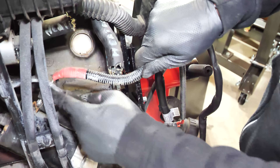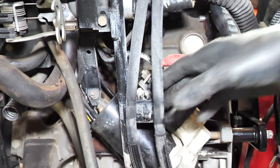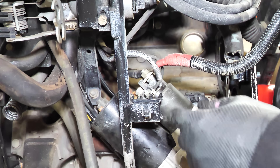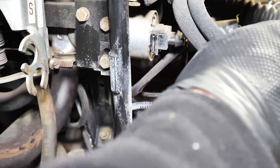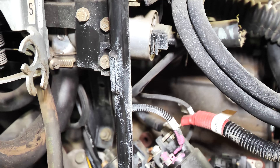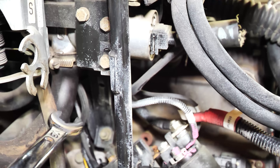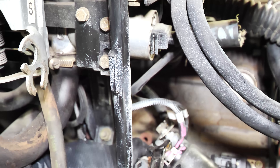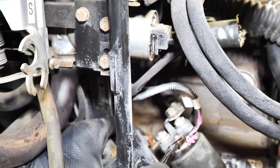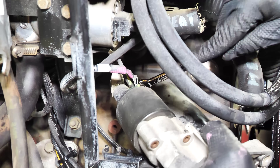The real hard part is actually re-hooking up the wiring. I think taking the starter out of the bell housing won't even be the hardest part — hooking the wires back up will be. So we're going to label all of this stuff. It's 13 mil on the starter in case you're wondering, and it's simple to get off. Obviously if the motor is in the car disconnect the battery first or you'll make some sparks.